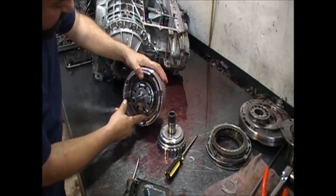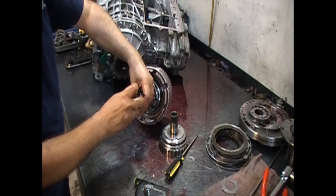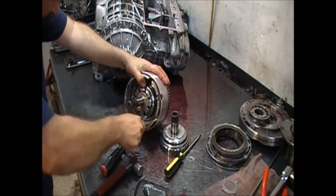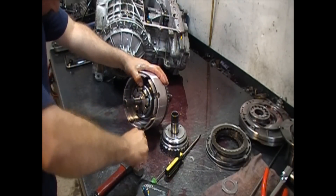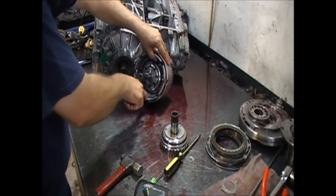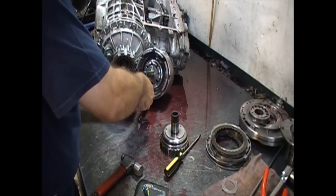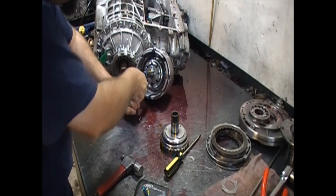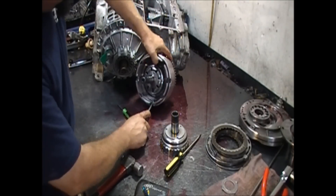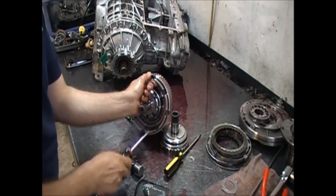The next snap ring is a tapered snap ring and it goes inside the groove pretty good, so I'm going to see if I can get behind it by tapping behind it. Sometimes you need a little pick to lift it up. It becomes a little difficult sometimes. I'm going to put it against the transmission so you can get a better shot. Here's my snap ring — rotate a little bit, hold it with my finger.